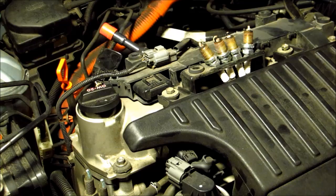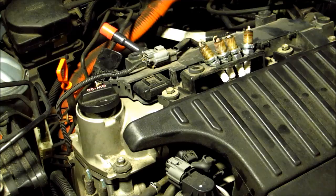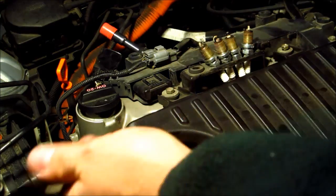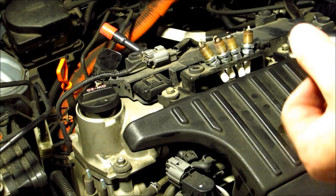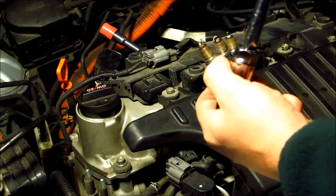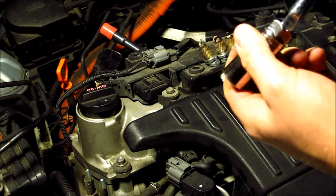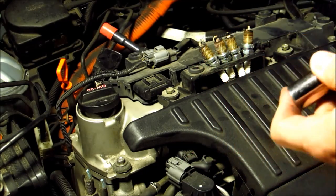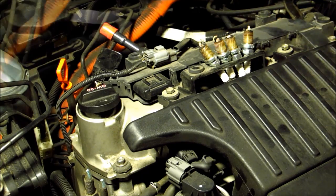So four and four — eight total spark plugs, two per cylinder. I usually work in fours: take all those out, and then take out the little rubber gasket, because I always find if I use that to put it back in, when I pull the socket out, it always leaves the plug in the hole. So pull those four, then put four in, and then do the other side.